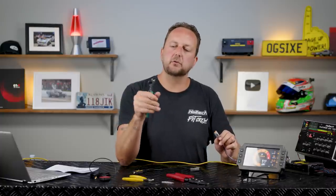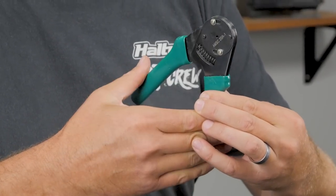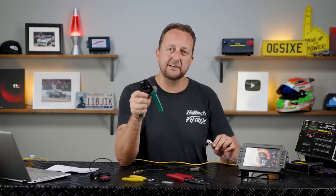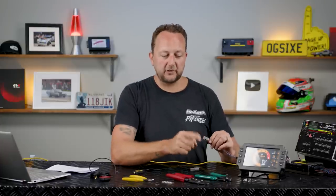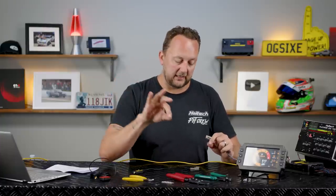For the Deutsch DTM pins supplied with the GPS puck, I've already crimped these using the 20-gauge DTM crimpers — they're available on our website and from lots of places, a really handy tool to have. You should be crimping Deutsch pins with this. If it's a one-off and you're in your garage, you might be able to use the back of your pliers, but I would never recommend soldering the wire to the back of the pin unless it's your absolute last resort — and in that case it'll also get the job done.